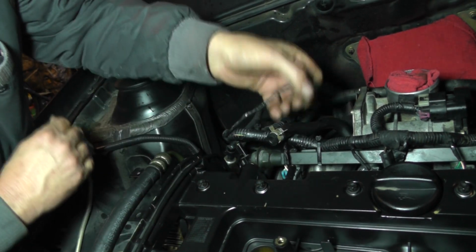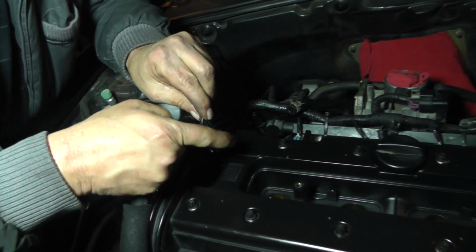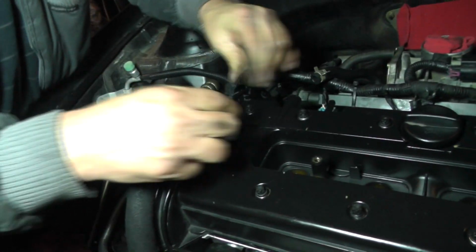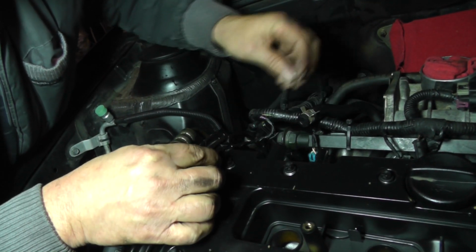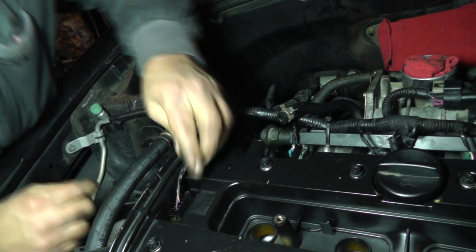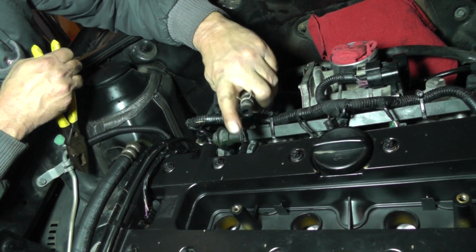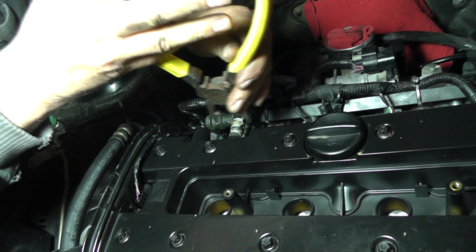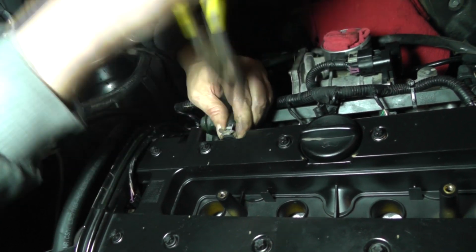Okay. Now let's take our camshaft sensor connector, wire bail to the back. And this one here has a little holder right there. There. Now he's there. Okay. Alright, let's take our ventilation hose. Let's hook him up right here. Let's get a clamp down on there. Right there.